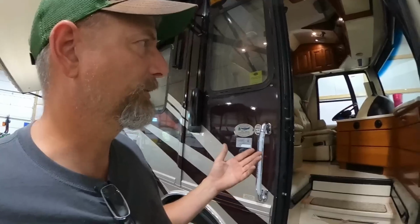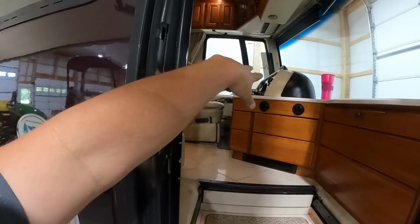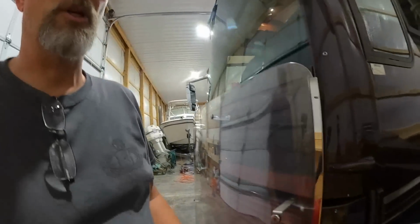All right, so we took the bus out for a test trip a couple days ago. And one of the things that didn't work was the AC blower didn't come on. The defroster blower comes on, but the AC blower doesn't. They're two separate things. So I tore the dash out, which I needed to do anyway, because there was a blinker light out. But it was a pain in the butt, and I hated that I did it. But I needed to fix that. And because on the forums, they said there was a fuse for the blower behind the dash, which is crazy, but whatever.